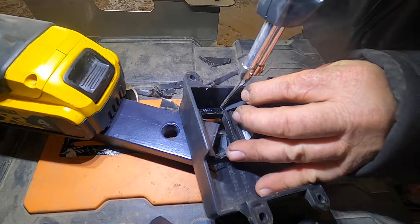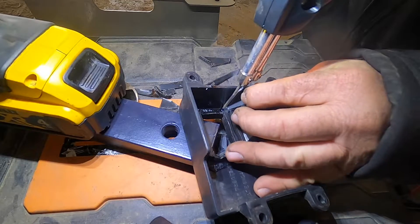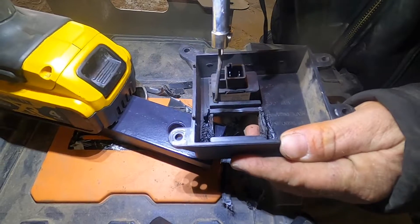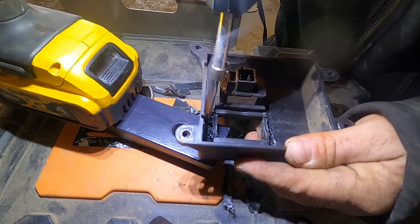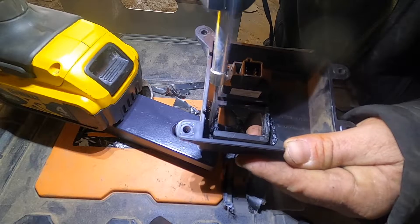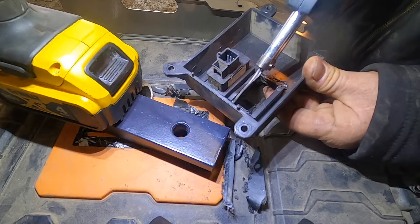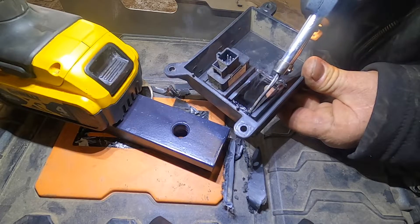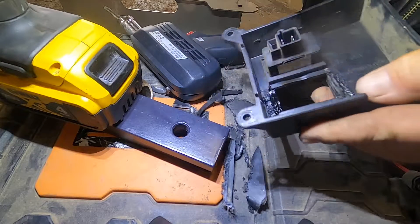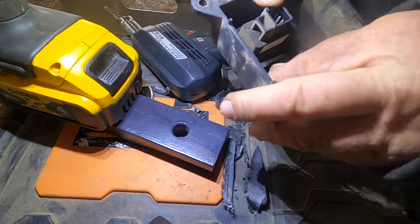I don't know if there's other material to use - I'm still using some of the plastic off of my Can-Am, that's what this is. It seems to work really good. I've got all my material in there now. I'm sorry, I'm trying to get you guys a shot - this is extremely hard to get in here. I don't know if anybody's ever tried this or not. You can actually use the iron to work material down - obviously I was a little high in there. While it's warm you can kind of tool it and get stuff cleaned off if you need to.